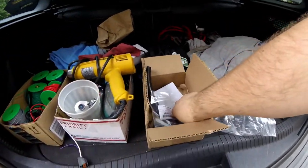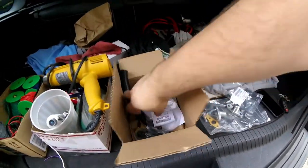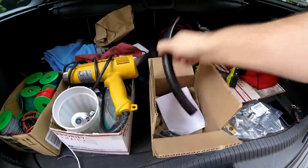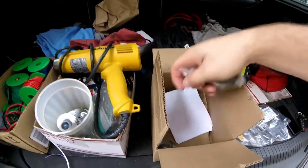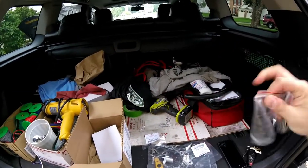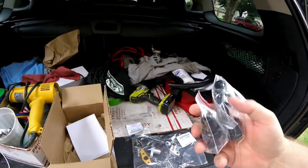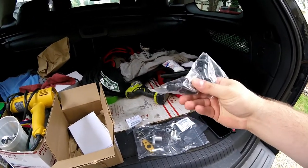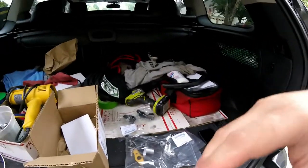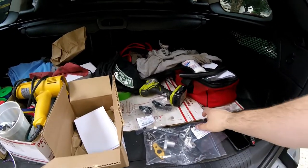So this is the setup right here. I got this from Extreme PSI, which is one of their basic kits that they sell. It's very simple to install. Basically what it is is a dash 10 return with push-lock fittings. I decided to go with it because they are about the same diameter, and I have never had any good luck with actual AN lines - they always seem to leak on me.